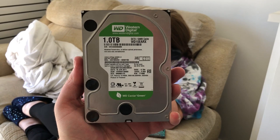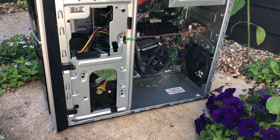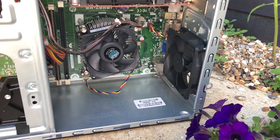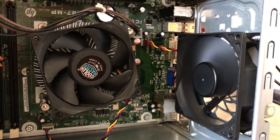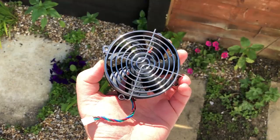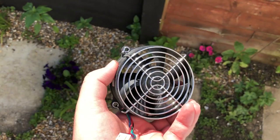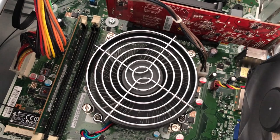To finalize, I added a second-hand one-terabyte hard drive to the build. The seller was kind enough to include the screws necessary to hold it in place, and once installed the PC should be good to go. But there was still a problem — we were still getting the same error message as before, and as it turns out the CPU fan is actually broken; it wasn't the dust after all. I do hope the fan is at fault and not the motherboard connector, so to test this I borrowed another fan from a different system. I removed the metal grated part as it looks silly and the fan blades were hitting it as it spins, causing it to make a noise.